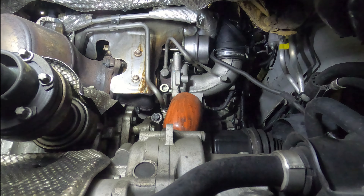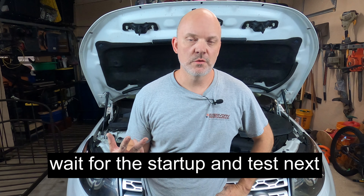That fluid movement and the ability to hold vacuum is what we're looking for. The wastegate actuator doesn't appear to be a problem. If it were, there are bolts you could remove to replace just that part — it would be a hassle but better than replacing the entire turbo. We got lucky: two issues, one much worse than the other. The solenoid was easy to reach and easy to troubleshoot. I want to warn you: do not assume it works just because it makes noise — just because it clicks doesn't mean everything inside is working.